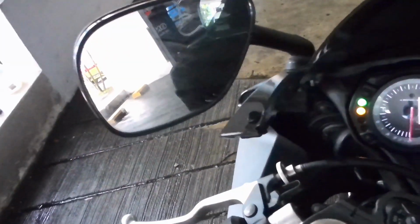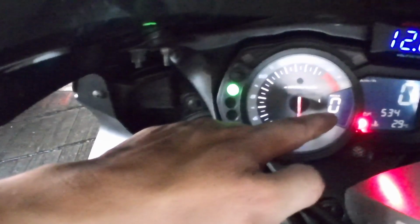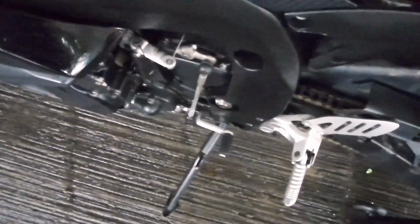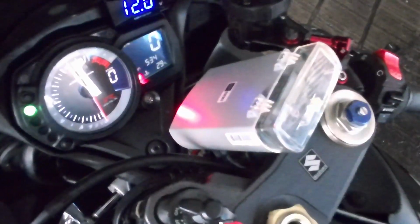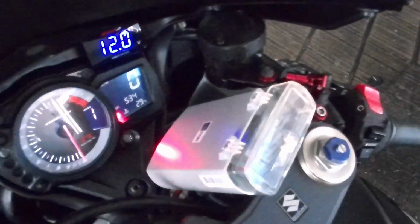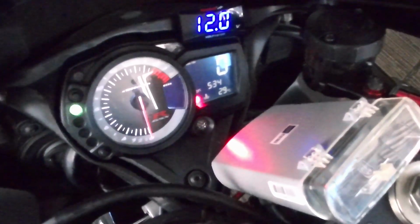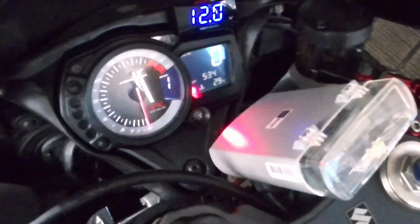After 2 days of riding, we noticed some interesting things with the gear positioning sensor. You will see the neutral light and the zero key on if the bike is on its side stand. If you leave it up, we engage gear one. Okay, we cannot find the neutral again, and gear two is also missing. So this is a very interesting thing.